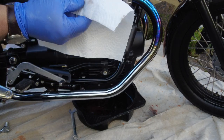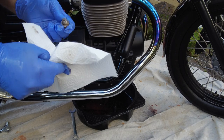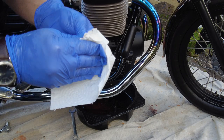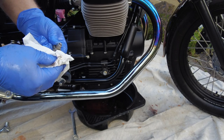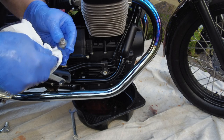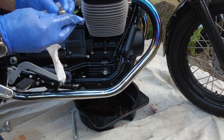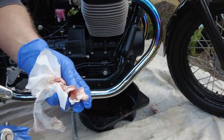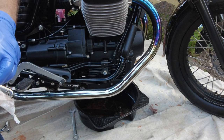There's lots of filthy stuff on this — see that. This mayonnaise stuff, as you can probably see, is indicative of water in the oil, so I'm glad I've got that drained out. The actual magnetic bit looks okay so no engine debris as such. We'll just give that a bit of time to fully drain before we try to refill. This is the main drain plug — there is a tiny little bit of swarf on the magnetic part, not massively so, doesn't look really that bad, but of course I shall remove it so it doesn't stay in the engine.